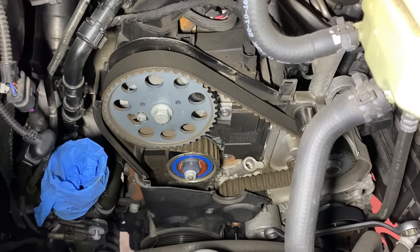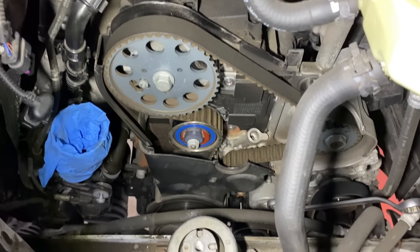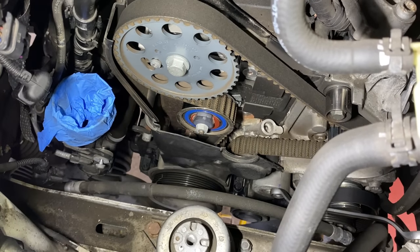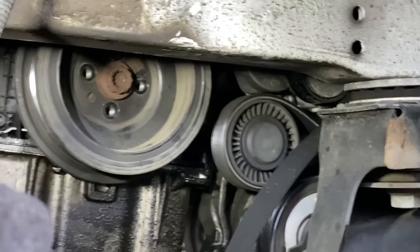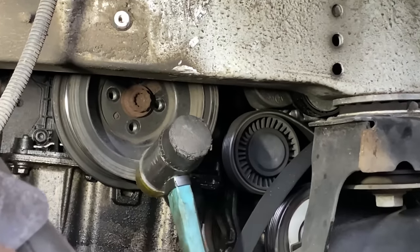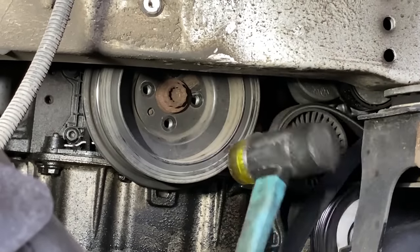And we still have to remove the crank pulley along with the tooth pulley, which is on there, because we gotta replace the crank seal. So let's take the crank pulley off with the plastic, and then we're gonna start stripping the timing down. So we are using plastic hammer instead of metal one, because we don't wanna damage the crank pulley. Just gonna tap it here and there so it will get a bit loose,